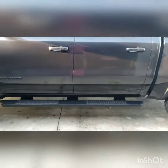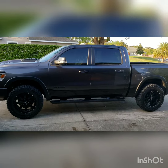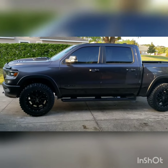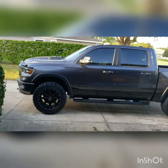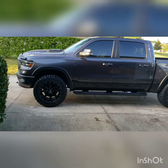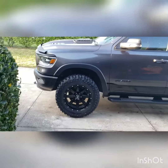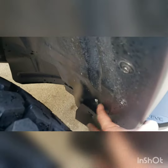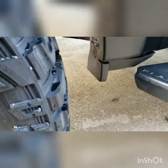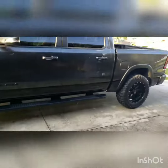The reason I'm adding this video is because literally when I was shopping for rims and tires, there's hardly any content about what will fit and what won't fit on these new 2019 trucks. But I'm here to tell you, if you're going with any kind of negative offset — 12, 18, 19 — which is pretty typical for a 10-wide — you're gonna have a little bit of rubbing if you go with a 35-inch tire. But it's really simple to fix: just bang this metal piece back and screw the flashing back, and that's it. You still retain the stock mud flap and everything, so it can be done.